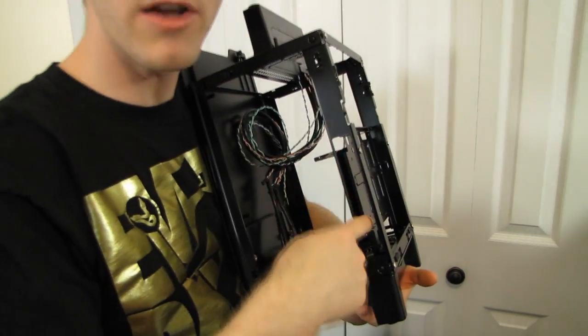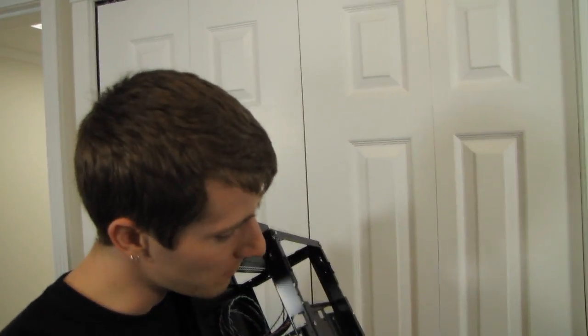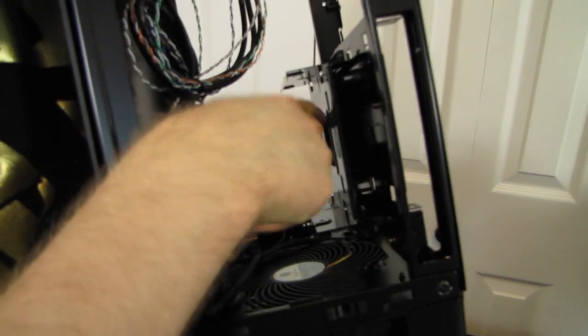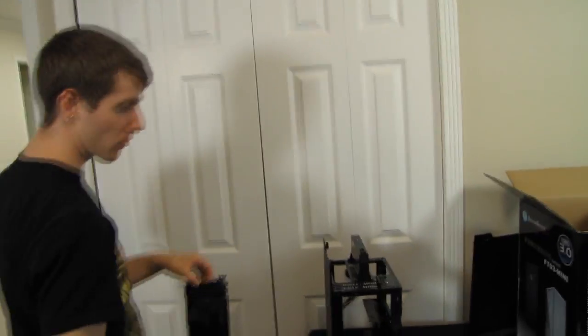Right, expansion. So you do have to use a slim slot loading optical. I think it makes the front look really nice. They're not that expensive. You can find them, so it's not that big of a deal. So you mount that in here. You've also got room for a 2.5-inch storage drive here and a 3.5-inch storage drive here. So you can fit everything you'd need for a high-performance system in this thing without any issues. High-performance graphics card, high-performance CPU, SSD, or even up to 3 SSDs if you use the 3.5-inch to dual SSD mount. And high-performance graphics card.